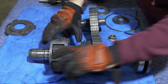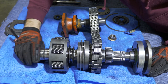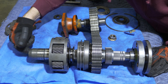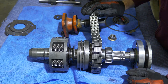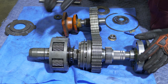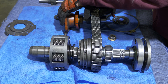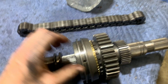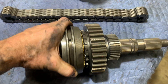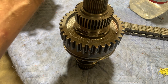As this guy turns, you have a one-to-one ratio in two-wheel drive high — one revolution of the shaft is going to be one revolution of the drive shaft. This is how things look normally. To go to four-wheel high, this slides back and locks the whole construct and will turn and turn this chain, driving obviously the front drive shaft. This drive gear right here is freewheeling when the range gear or the four-wheel drive selector is not engaged. As we slide this back, we lock it in and it now spins two — two-wheel drive, four-wheel drive.